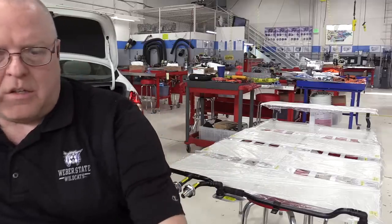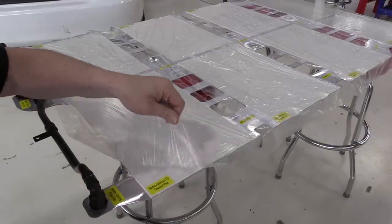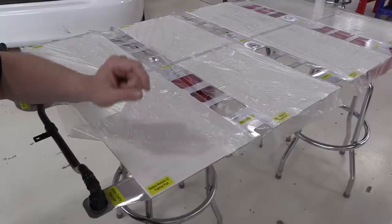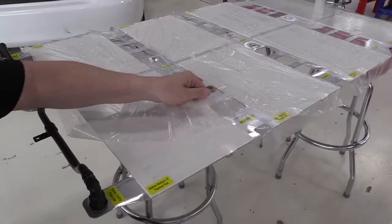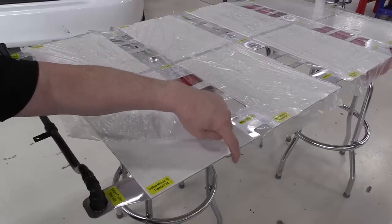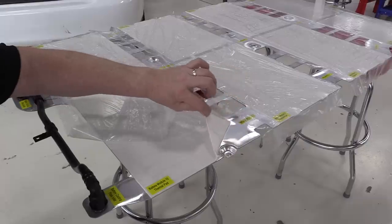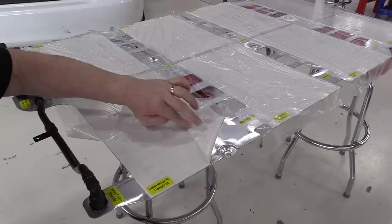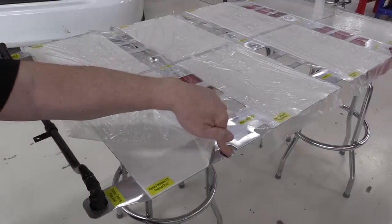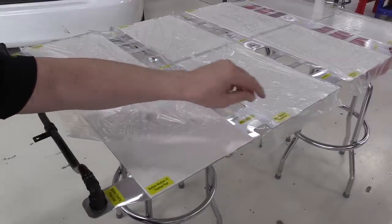Let's take a look at these thermal pads a little closer. As you can see right here, I'm just peeling up the seat cover material. I've washed my hand. There's a bolt hole underneath this section of this thermal pad here for battery module 10. I would recommend that you just simply peel that up and stick it to itself enough to take the bolt out or put it back in. And then when you're done, just lay it back down.